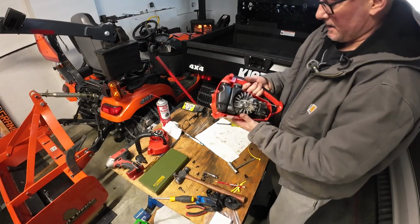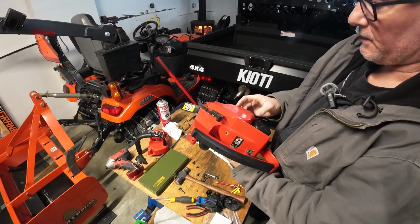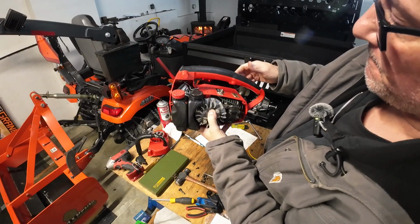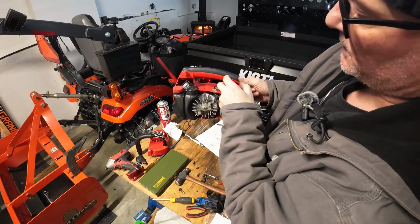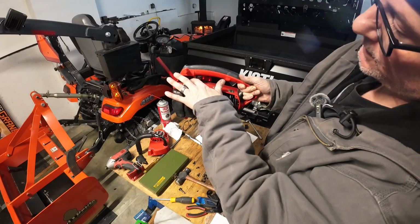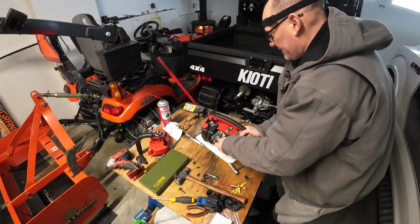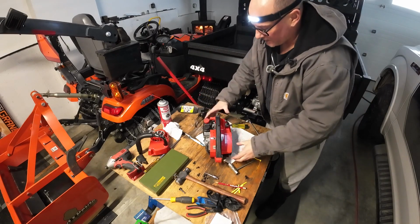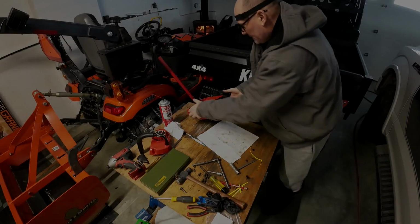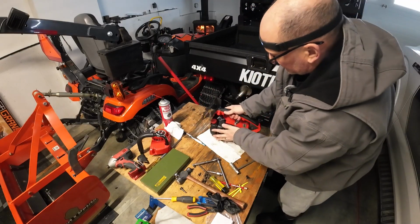Okay, so that was a long process. So before you put the kill switch in, and before you put the brake bar on and the clutch piece all in there, the linkage for the throttle has to be clipped into the throttle side as you're sliding this whole thing in. You leave this side out on an angle, and you can just get the top throttle linkage in. So there you go. So you got to do that first. Then you can put the brake and all that back on. There. Now we're back to where we were, but we actually have a throttle. So that's good.